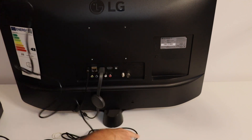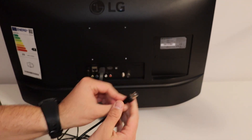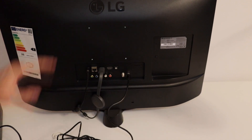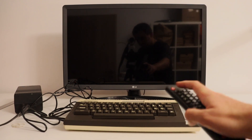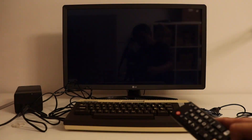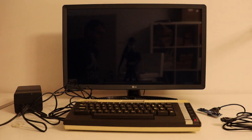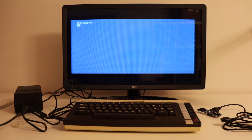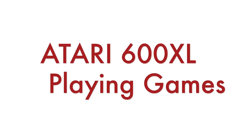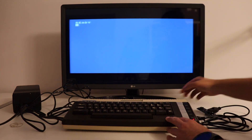The next step to get video output is to plug the antenna cable into the RF input connector on the back of my TV. As of 2022 it's still possible to buy TVs with an antenna input on the European market — I purchased this LG TV earlier this year. Using the remote control I switch the source to live TV. Note that before recording I already went through the procedure for finding the analog channel from the TV settings. Finally, I'm ready to turn on my gorgeous Atari 600XL — the red LED on the right side turns on, and on the TV we can see and hear that the computer is ready.